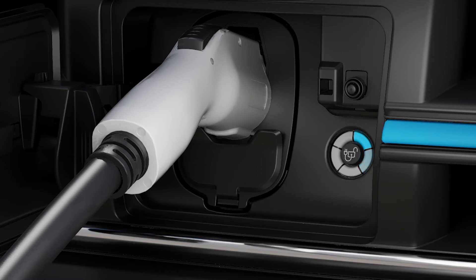When the lights illuminate, this means that a proper connection has been made and a normal charge cycle has begun. If you see an orange or amber light, this indicates a fault. If the light is flashing, there's an issue with the charger. If the light is solid, the issue is with the vehicle.